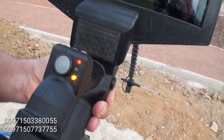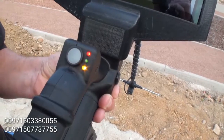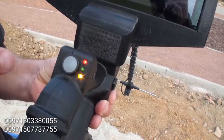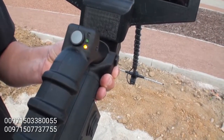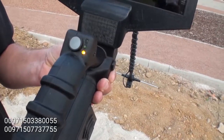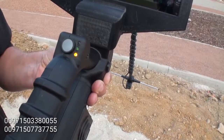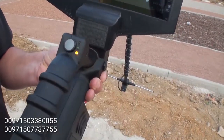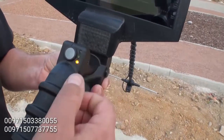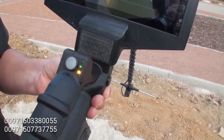In order to begin my scan, all I have to do at this point is push the multi-function button. The green light will blink. The red light is off, meaning it is no longer stopped. With the green light blinking, it is transferring data. The yellow light indicates a successful Bluetooth connection.